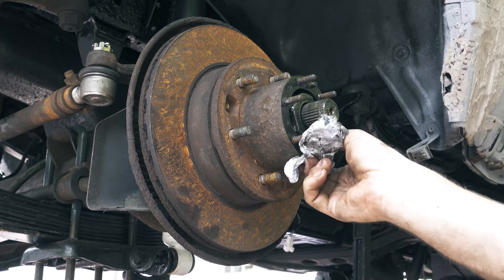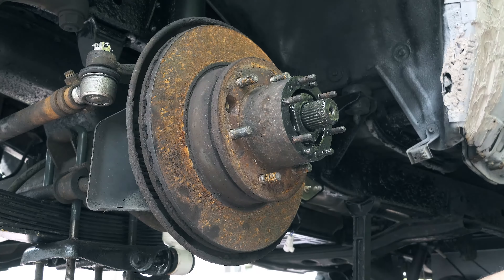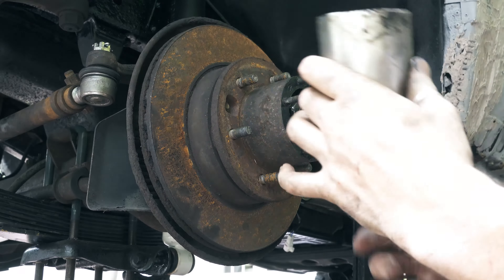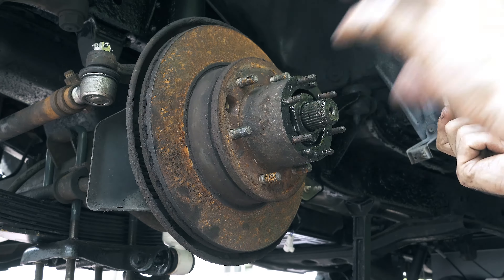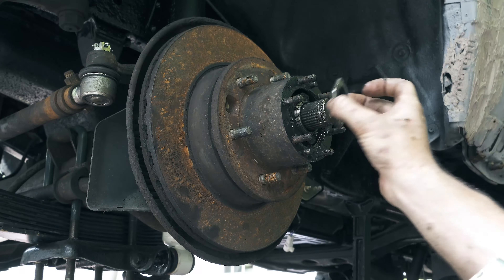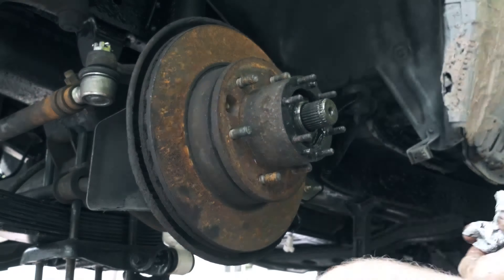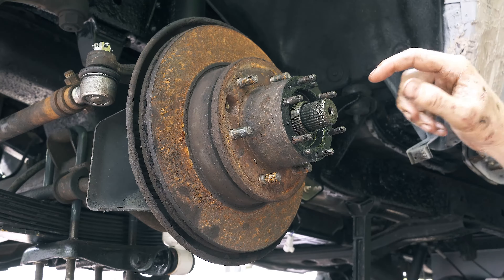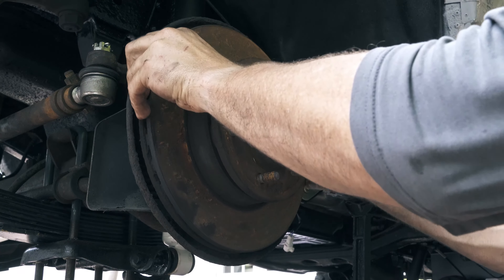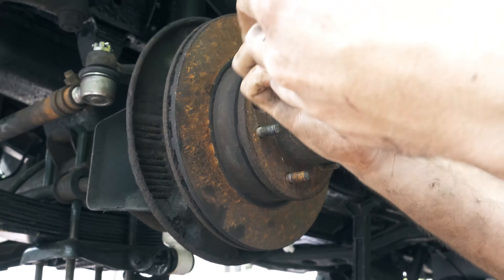There's some grease or oil coming out — you might have a deep oil leak into this thing. Now this is where your 52 millimeter comes in. There are actually two nuts you've got to get off: there's one, then a weird kind of washer, and then another one. Once those are off, anything left inside should be another washer and a bearing, and you should be able to pull the whole hub off right now — and you'll see a very dirty greasy bearing.